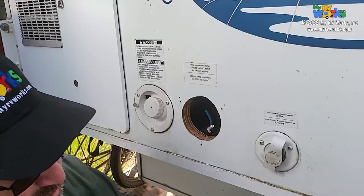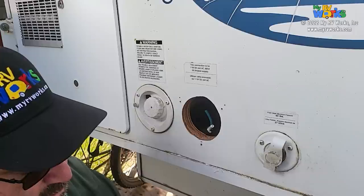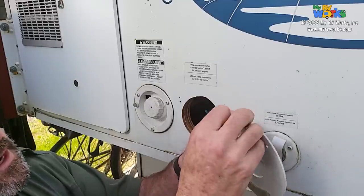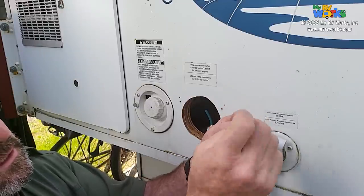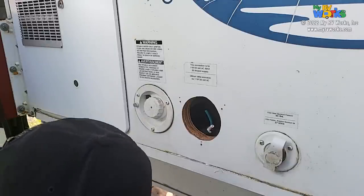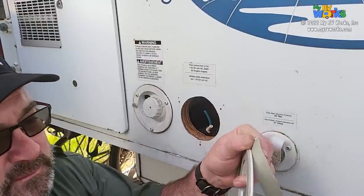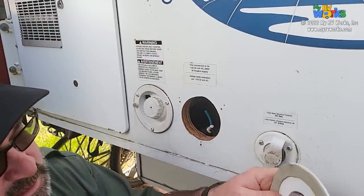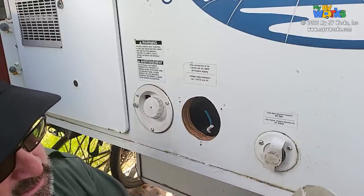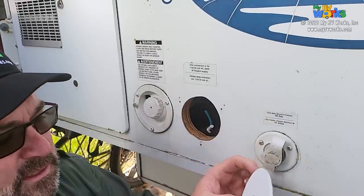I'm going to go right to the edge. What I really want to make sure is that the mastic, let's call it mastic again, the butyl, is covering my screw holes. Okay, I'm doing it where it's convenient for me to grab, but I'll show you when I get done. So you see what we're doing, okay? And I need a little piece, maybe like that long. And when you do circles, sometimes it's easier just to take the craft paper off the back. Okay. And this will help the water to stay out. So we have put it on the outside.